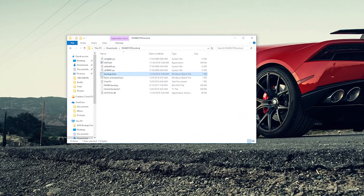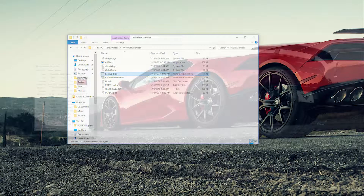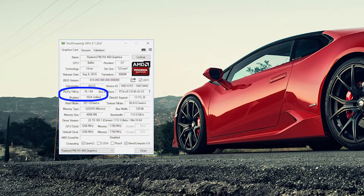Inside the file you download you'll see a backup BIOS batch file, and you definitely want to click on that to backup your BIOS. This will then add a file to that folder of your backup in case things go wrong. Right after that you can run the flash unlocked BIOS batch file and let the command prompt do its thing and you'll be good to go. You can pop open GPU-Z again and see that you now have 64 TMUs and 1024 shaders.